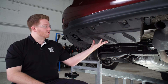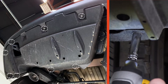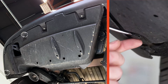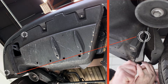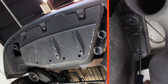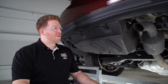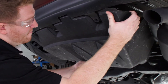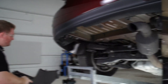To start, we're going to prep the underbody of our vehicle by removing this underbody panel. It's held in by 13 fasteners. We're going to start by removing eight screws using a 10 millimeter socket. Next, we're going to remove three push pin fasteners — the third push pin will be behind the driver's side lining in the wheel well. Last, we're going to remove these two twist fasteners on the passenger side. With all our fasteners removed, we'll go ahead and remove our underbody panel and set this aside to reinstall later.